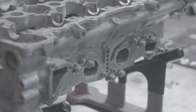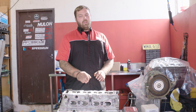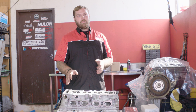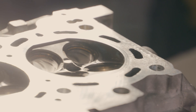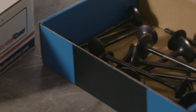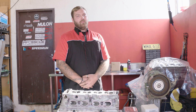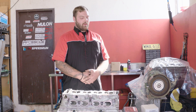On this one here we've done porting on the exhaust ports and also taken the guide bosses out, so the tip of the guides are gone. That way we get more flow through the exhaust — not so much the intake because they're already so big, so we leave those in. We're also decking it and drilling it for half inch. We lap the valves in and polish them — put them on the linisher, clean them all up like brand new. Out of all the cars we've done, Kelford seems to be the best for our setup.